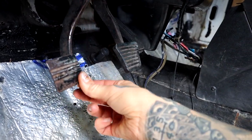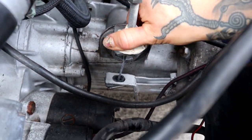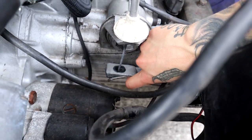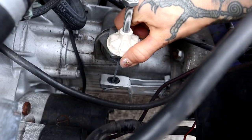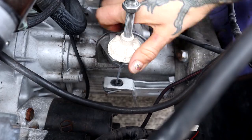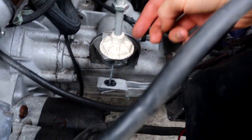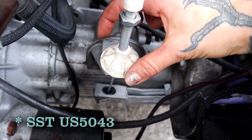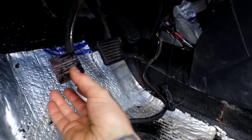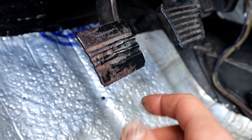You see how excessive that is? That's way more than an inch. To reduce the amount of free play, we'll righty-tighty it. As I'm turning that, you can see how this lever is actually coming up — because the throwout bearing is actually all the way on this side. Now that's really tight, there's no play there at all. There's actually a Volkswagen special service tool you can put between the bottom of the washer and the flat plate on some models to take a measurement right here under the hood, but that tool is impossible to find. You can probably make one, but why make one when you can just use a regular tape measure? Now you can see that is not sufficient free play at all, so I've got to get back to homeostasis.